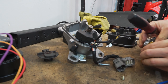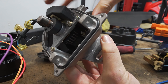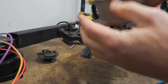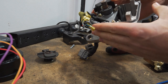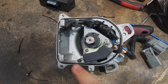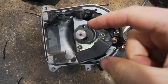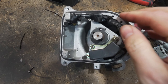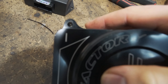In here we've got our home signal still, and inside there are more teeth which give us our individual pulses for each cylinder. I'm just going to tape up this wiring and put it back inside the cover, just in case I want to reverse the modification back to the distributor. I moved the wiring harness around the side here to make sure it doesn't come in contact with this pickup, and I put a cable tie through that hole so the harness can't move.